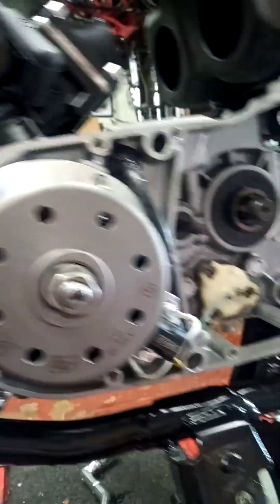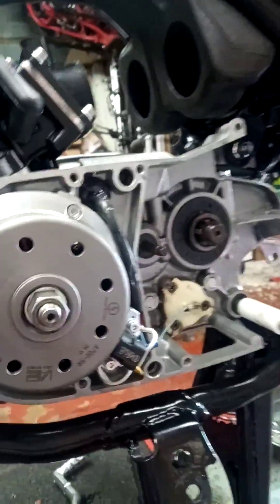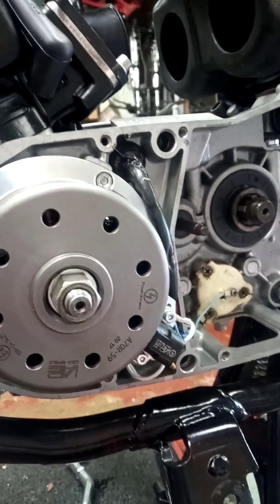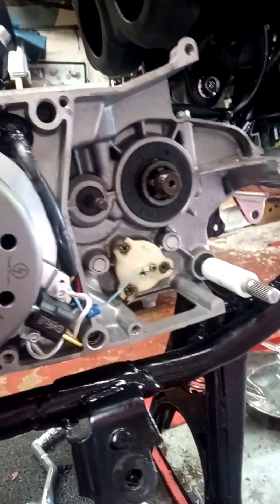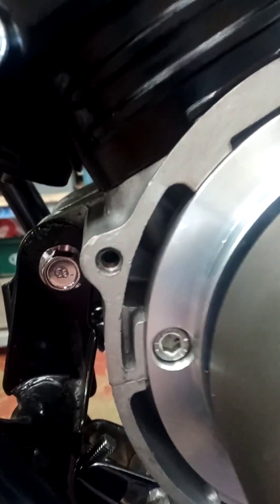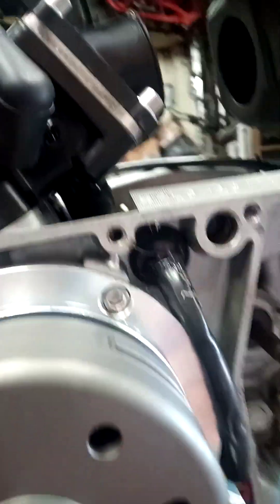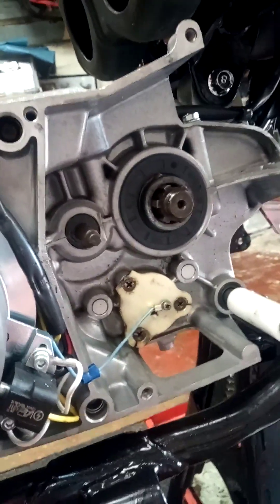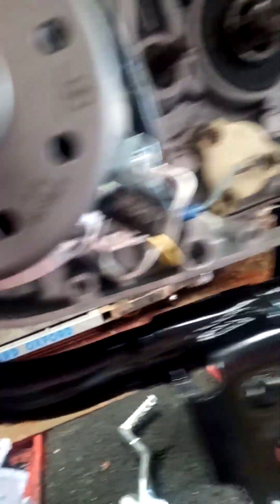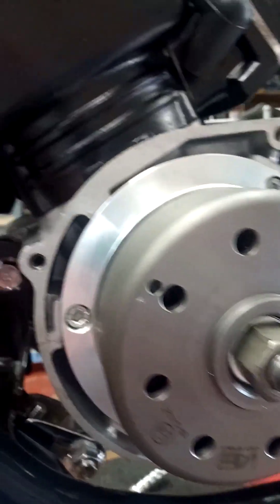I decided I'd turn my attention to the engine. What I've got - and I've had this before when I've had engines built and they've been blasted clean - is all the screw holes will have some kind of rubbish inside them, whether it be old gasket glue or just basic junk from the cleaning process. Before I've put cases on, I found the screws didn't fit and then found out there was junk inside.